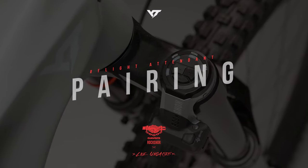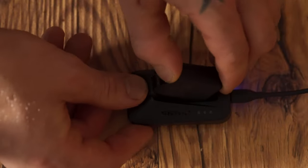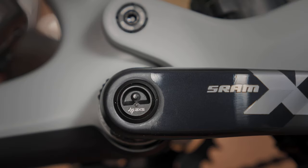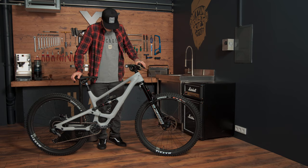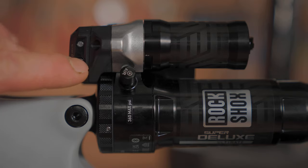To get set up for our first ride, it's necessary to pair the whole AXS system. The pairing takes only a few minutes. Before we jump into the setup, make sure all batteries are fully charged and all components show a green light after pushing the AXS button on each device. You may have to move the bike and compress the rear shock a couple of times to wake it up, or just push the AXS button.